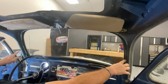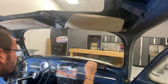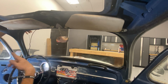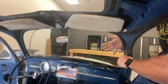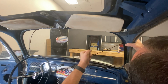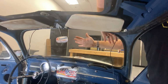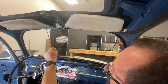and over. Once you get up the A-pillars a little bit, go on the outside and try and press the windshield in place a little bit more. You can just come in right here. You guys probably can't see this, but the same process of pulling that lip over right there. That's what we did there. Again, push the windshield in. And pull that rubber down. And like so.